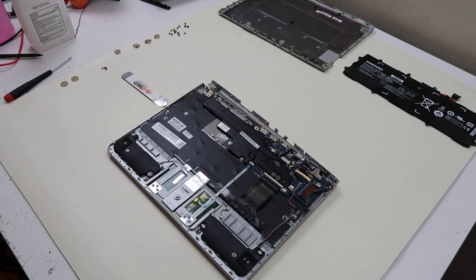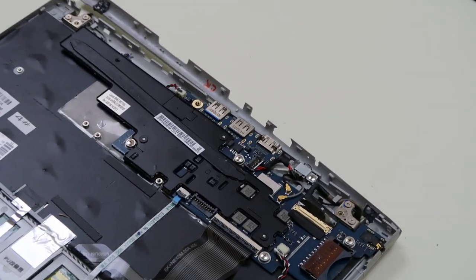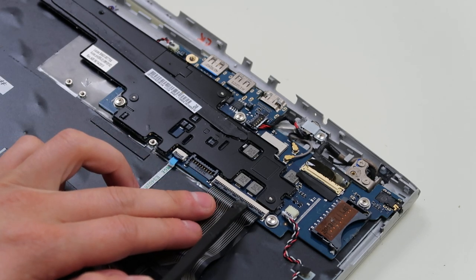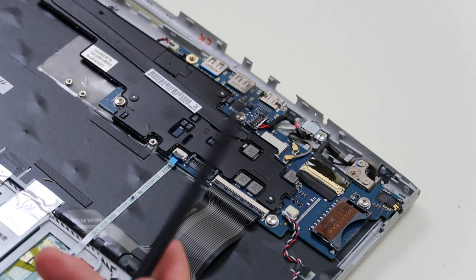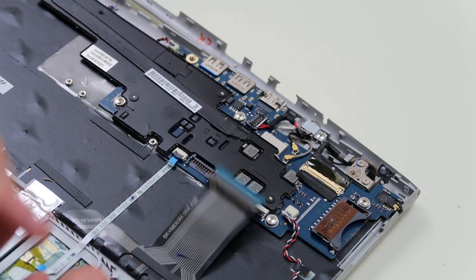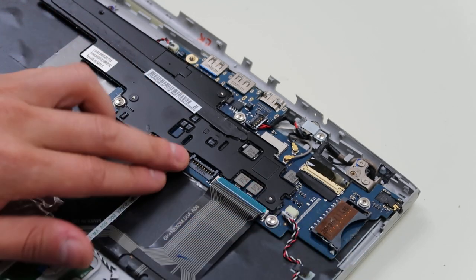So here's your motherboard. I'm going to zoom in a little here for you, because I'll show you exactly what's going on with the motherboard. We have a variety of connectors. You have right here a pretty standard motherboard ribbon cable clip connector. There's a plastic part here — it goes down to secure the ribbon and pops up to release. So with my plastic pry tool, I'm just going to pop that up and then slide this out. I always pop them back down for safety. Those are very breakable, and if they break, you're kind of screwed because it's hard to find them.